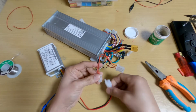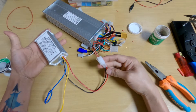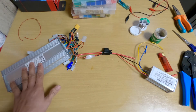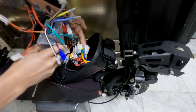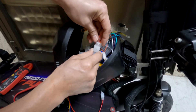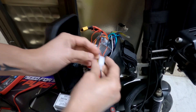Finally, the controller and the DC to DC converter are ready to be connected to each other. You can also put a fuse between the controller and the DC to DC converter for safety purposes. If a short circuit happens, the fuse will heat up and melt, opening a gap in the circuit and stopping the flow of current, preventing other components from getting damaged. Time to test the converter — I first connected the key ignition, then the converter, and then the battery.